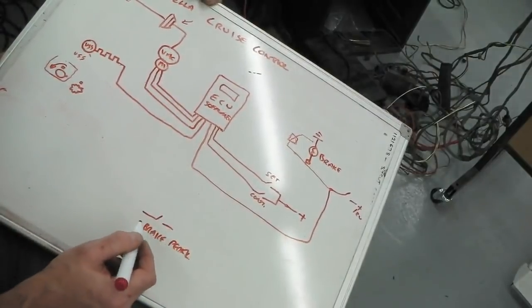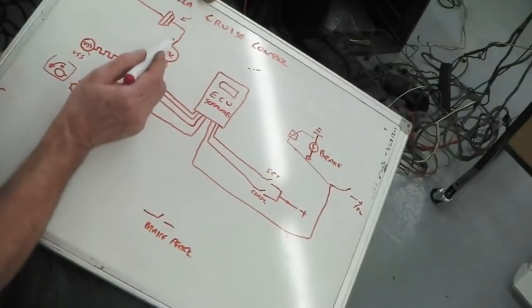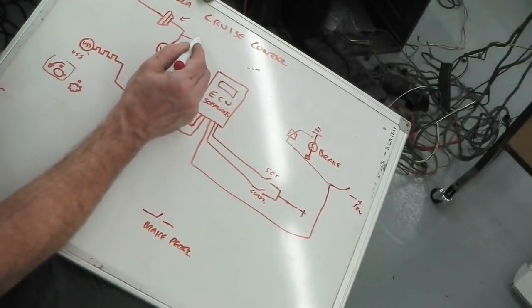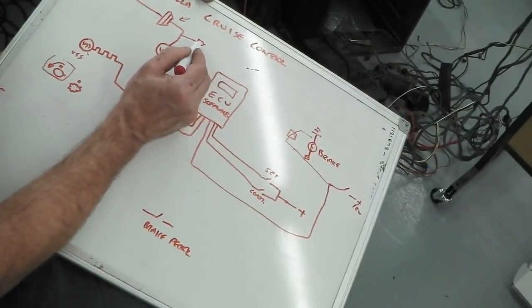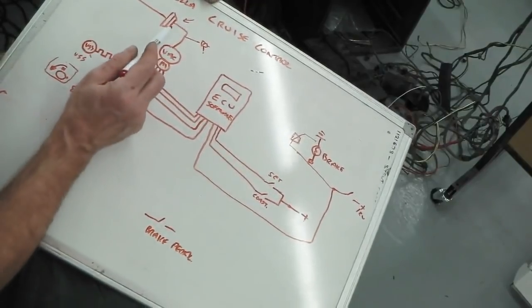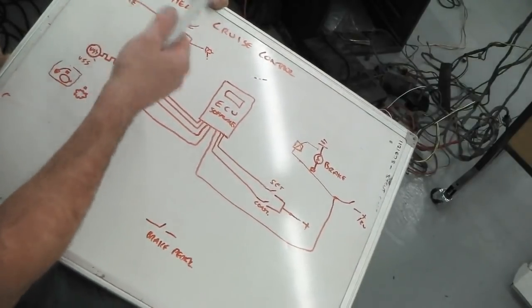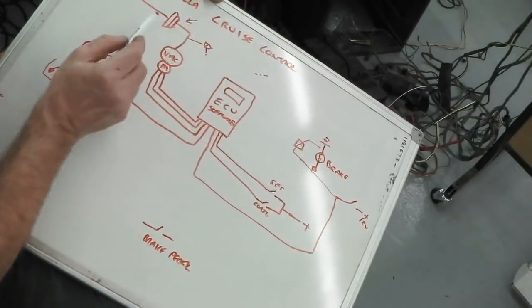They also have a safety switch, actually a physical safety switch on your brake pedal as well. The vac pipe here actually tees off and goes to your switch on your brake pedal. You have to get this with the kit. And when you press your brake pedal, it actually physically opens the valve and dumps the air out. So even if the computer failed to dump the air and knock the cruise off, basically knock the throttle back to naught, at least your foot on your pedal is going to physically dump the air out of this.